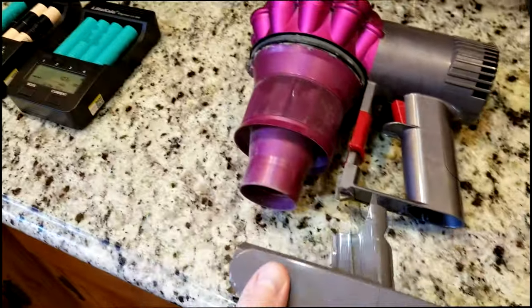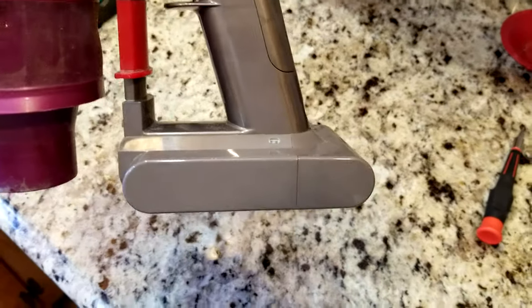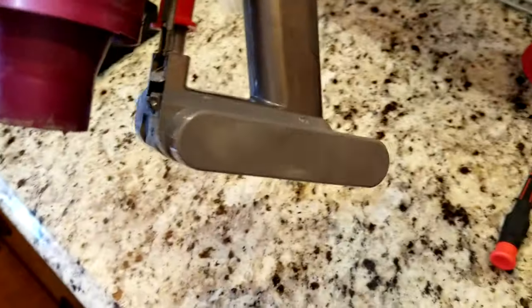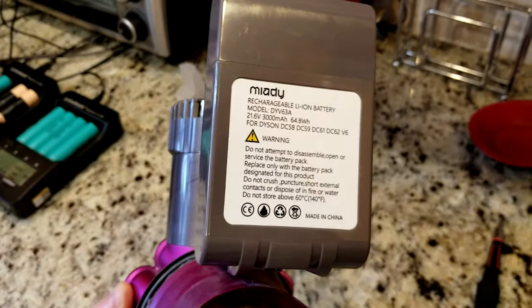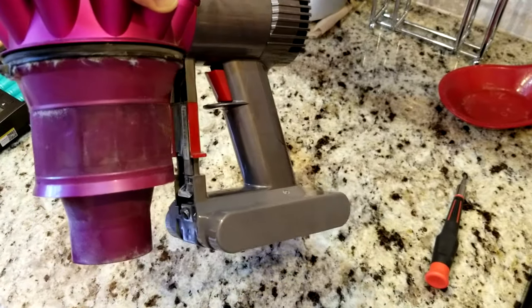With the old one out, all we do is use two hands and insert the new battery back up, screw in both screws, just like that. Make sure those screws are nice and tight without stripping them. Then I would charge it fully — it probably already has a full charge, maybe 80–90%, but go ahead and leave it on the charger for a little bit to juice those 18650 cells up.